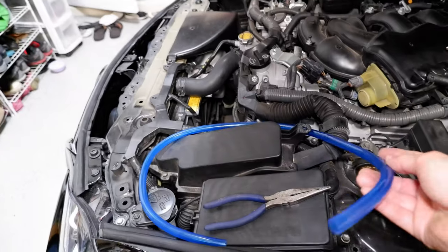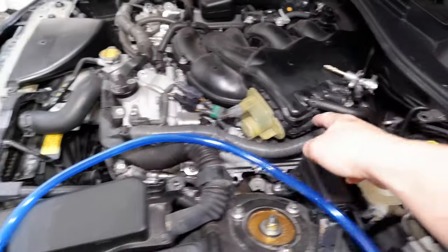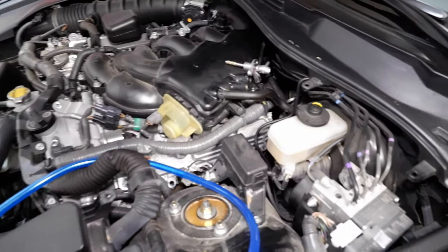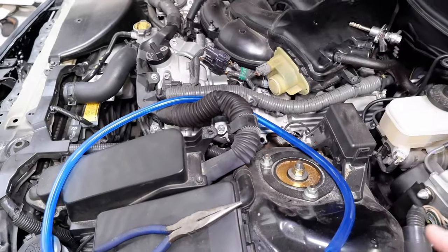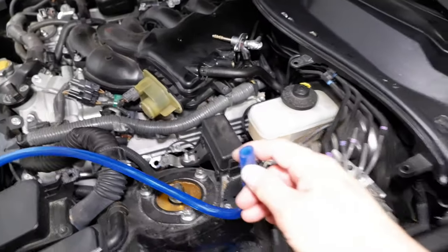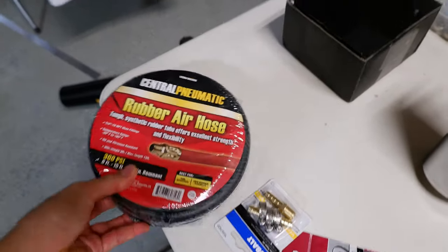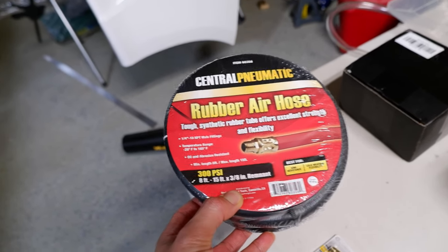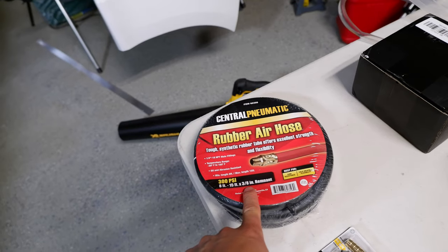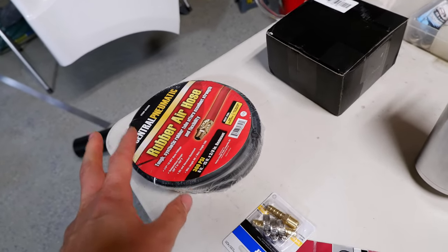I ran into a little snag. The hose that came with the canister wasn't long enough, because you basically need two hose pieces the length from that spot all the way down there. Most people mount it a lot closer to the PCV valve, but the way our cars are you've got to mount it down there. So I'm going to have to make a run to pick up some hoses and another connector piece. I ran down to Harbor Freight and picked up some air hose - a remnant for like $6, minimum 8 feet up to 15 feet. It's the perfect size - I was looking for basically 3/8 inch, which is the same as the hose that came with the can, perfect for all the nipples and fittings.